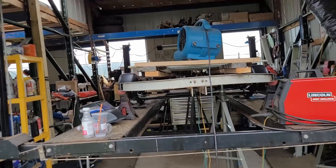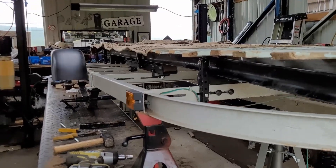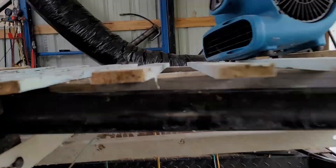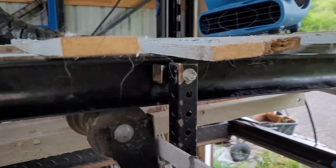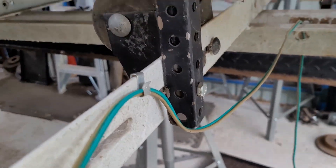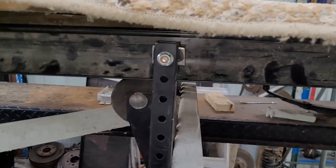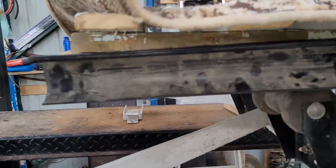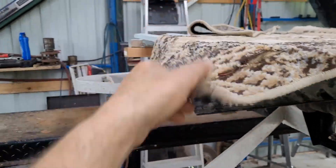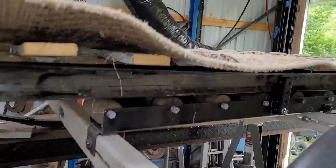Dana here and welcome to Searching For. This update is as to where I'm at with Elizabeth's trailer. What I've been doing today is making guides — I had some form metal here, cut it up, and bolted it in place. I may eventually weld them. I left two pieces at 14 inches back here, so when we're lining it up coming in off the water, it should line right up and slide right on here.